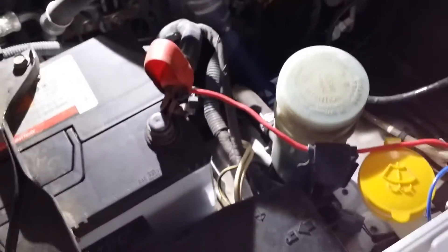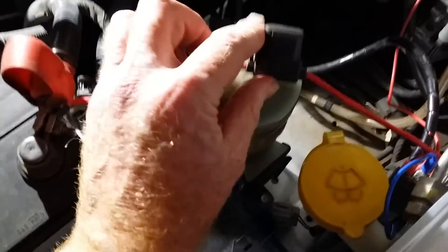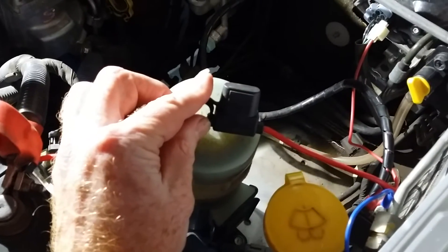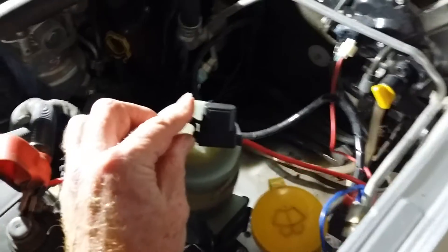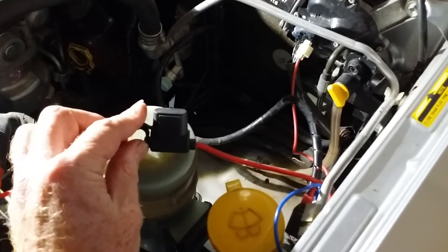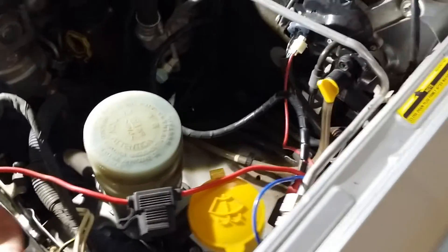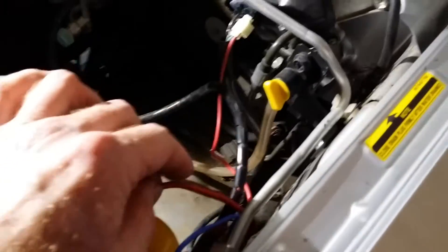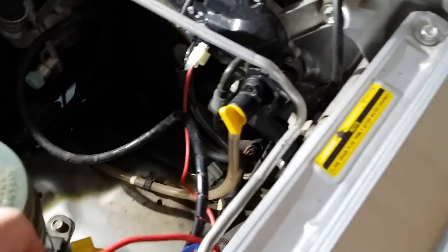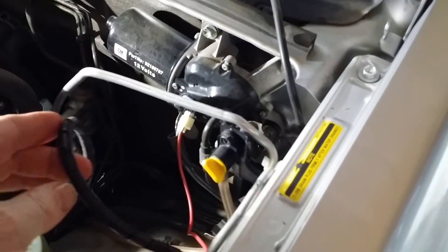You can also see my power wire — it's about five or six mil, which is fused. It runs a waterproof fuse and I run about 20 amp in there. Just have a look at your fridge — you'll be running maybe 12-13 amp, so a 20 amp fuse will be okay. Make it waterproof and that goes direct to your battery. When the switch is on, power runs down this wire all the way underneath the car to the 12-pin plug at the back.